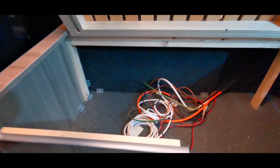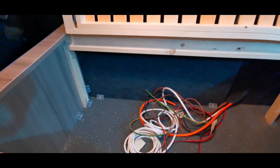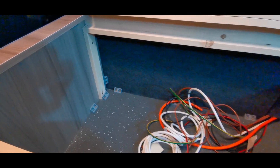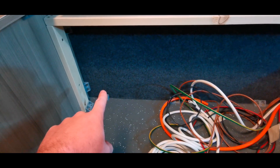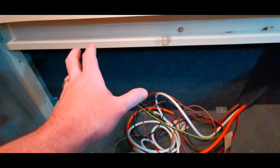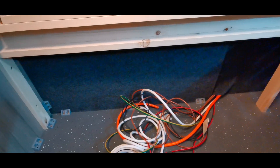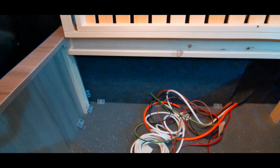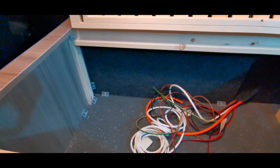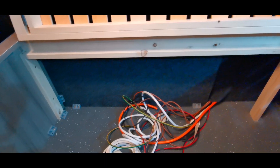I'm going to take the bed front side while I'm doing the electrics, and it's going to be easier for getting in and out of the van while I make the sink. The electrics are going down at this point — I've got the 12 volt in that corner. I'm going to be putting a charger unit in there. I've upgraded to a 20 amp charger rather than sticking to the 10 amp. I've got a bigger battery — a sealed 110 amp leisure battery going in this one.